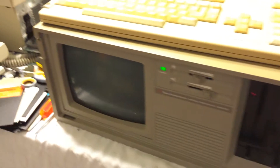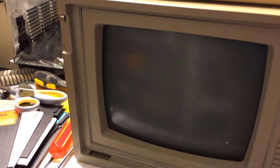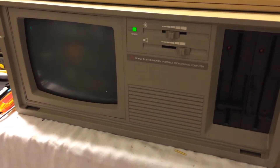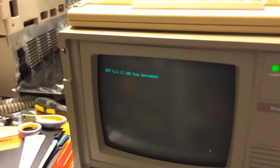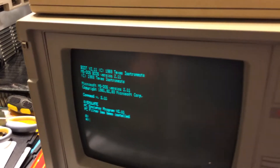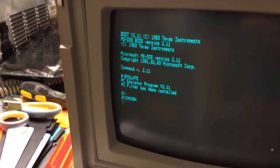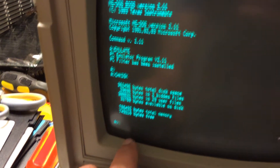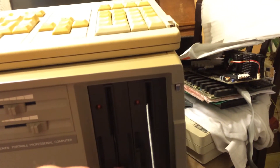Getting all the screws back in. I've got a blinking cursor - it didn't die. That's the only way we'll know if it worked: do the check disk. 768K worked! Oh my gosh, great! No jumpers - wow, it just freaking worked!